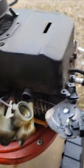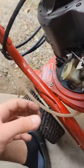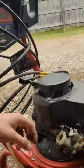I'm almost positive it's the carburetor because usually it is, but you never know. So don't mind the safety glasses, it's because I'm spraying carb clean. Yeah, it's one of those junk plastic carbs, but I think we got it. The main jet was kind of clogged. So we'll get that all put back together. I have to put these O-rings back on, but...